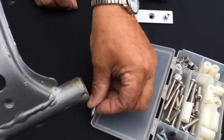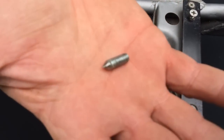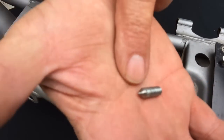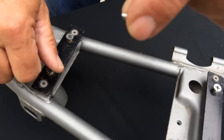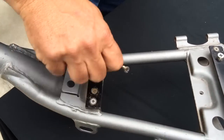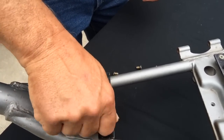Here's a little trick I'm going to show you. What I'm holding in my hand is a quarter-twenty bolt that's had the head cut off and sharpened to a point. When you get your seat mounts made, you can remove your screws and screw these sharpened bolts in.